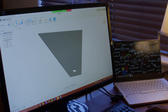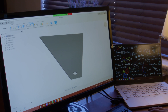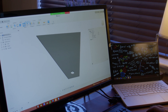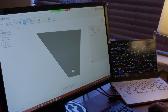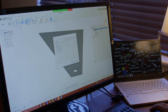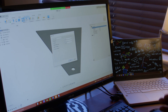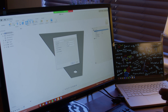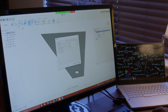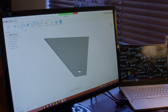This is kind of the main bracket. We can come to modify sheet metal rules — steel is in here — and we're going to be using a hundred and four thousandths thick, so I'm going to change that to 104. K-factor has to do with the stretch — I'm going to talk about that in a little bit. If you go on to SendCutSend's website you can see some values for that. We'll close and now that we have those set, we can start bending.